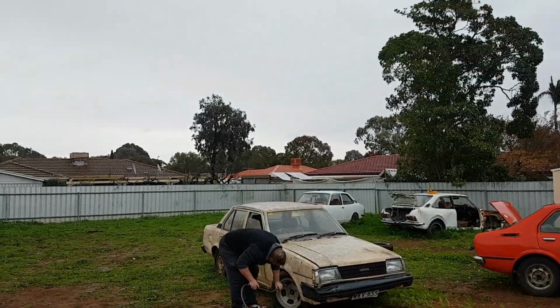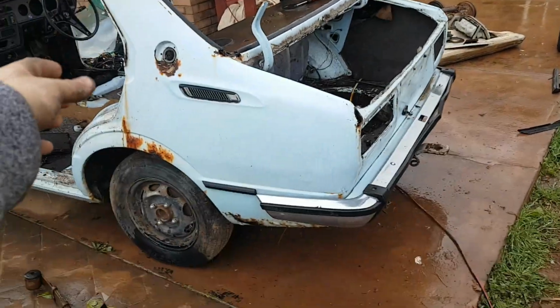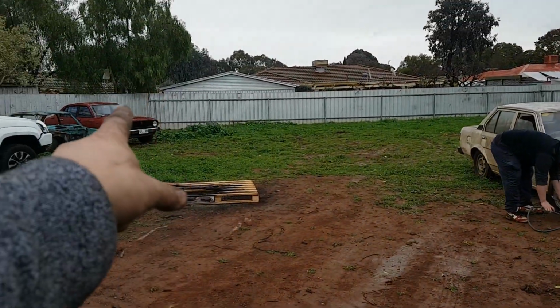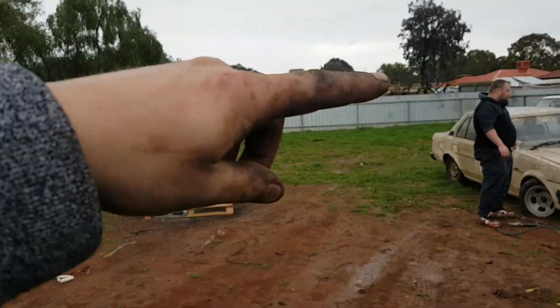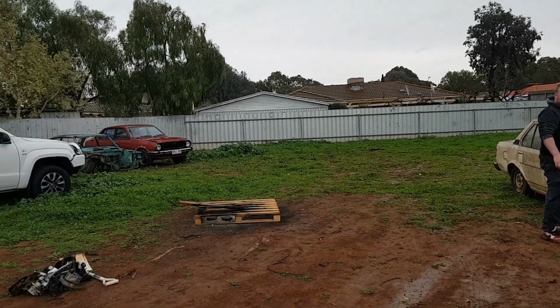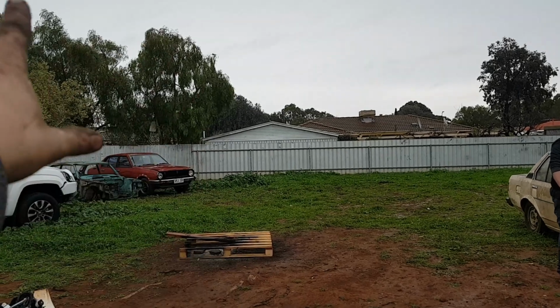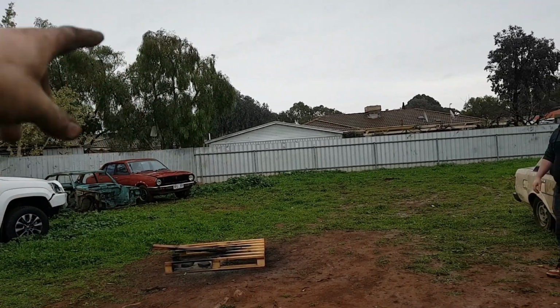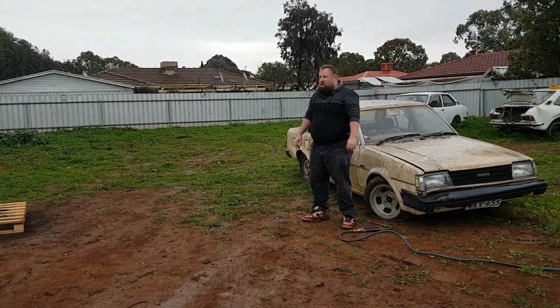So it's miserable weather today. We were pulling apart the 55 and got kind of sick of that immediately. So we made the other 55 run. Luke put the radiator in that, hooked up the trans lines and hooked up the radiator lines. And then we filled it with trans fluid and that's sweet now. So that's pretty much done mechanically. Just got to wire up a fan and paint it and then I can drive it.